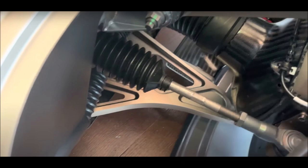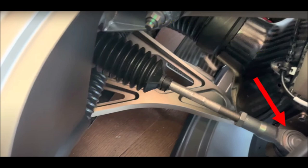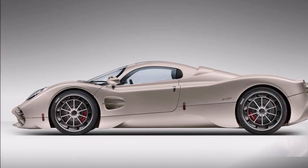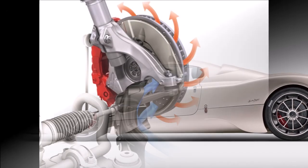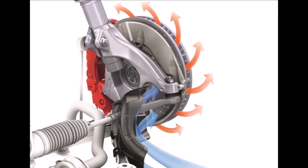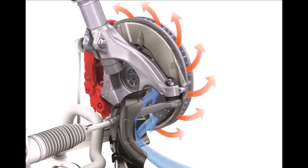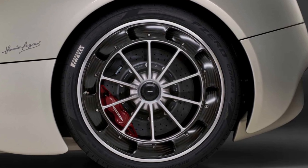When looking at the front suspension, you could think that the Utopia has front-wheel drive as well, but this is actually the front brake cooling — it's just integrated so well that it looks a bit like a huge driveshaft. You can see that the steering rack is in front of the front axle to have enough space for the pedal box, which then requires the brake calipers to be behind the front axle. Brake cooling goes to the center of the brake, because the disc vents hot air outboard and sucks cold air from the center. The rims now have a modular element which vents air outboard to improve brake cooling.